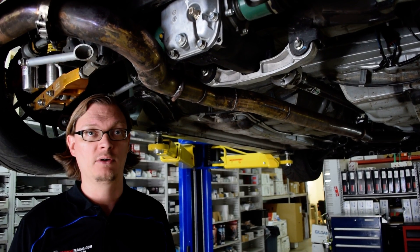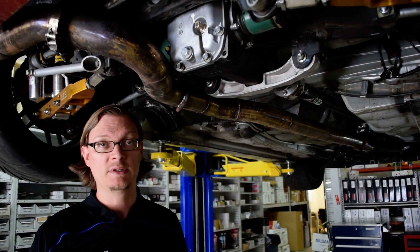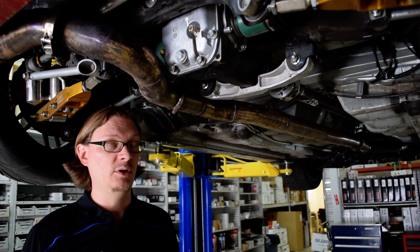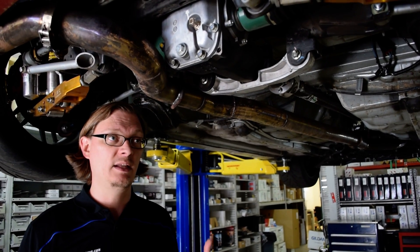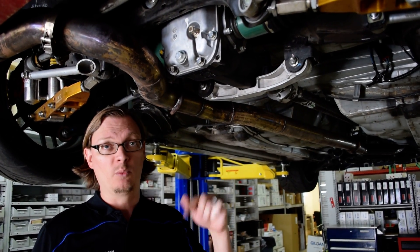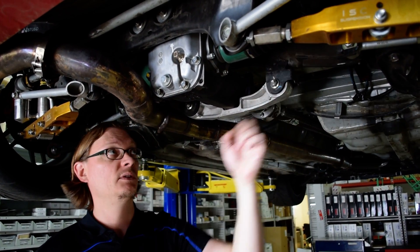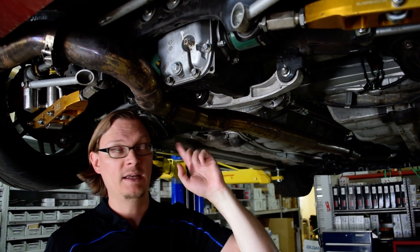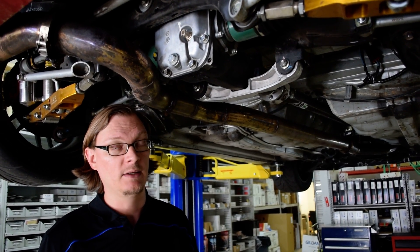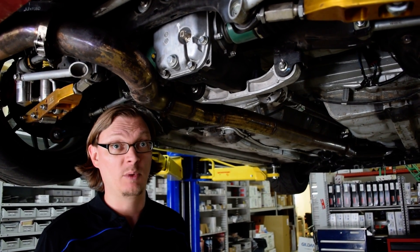The next question is what axles do you use, because the axles for an R180 and an R160 where they bolt into the diff are different. On the older cars you have to do a hybrid axle. It turns out that on the new cars — at least 2011 to 2014 and possibly 2008 to 2014 — they changed the bearing in the rear only, so the rear hubs on the WRX will accept an STI axle. So we have simply STI axles. We put in an STI R180 diff and STI axles, and it bolts right into the hub — you don't have to change anything suspension-wise or hub-wise. It's an extra expense, but because it just bolts up nice and simple, it made the swap really easy.